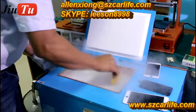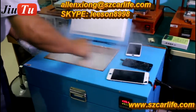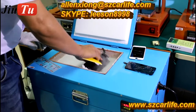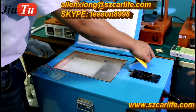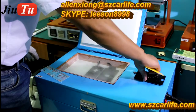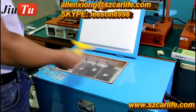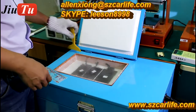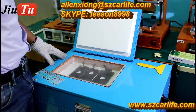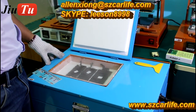While the machine goes up to this kind of low temperature, it will need around 15 to 20 minutes. But once it reaches that cold temperature, you can just put the cracked glass here for 20 to 30 seconds. If you have a lot of cracked LCDs, you can collect them together and separate them together within one or two hours, which makes your separation much quicker.